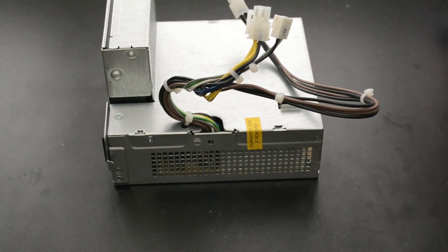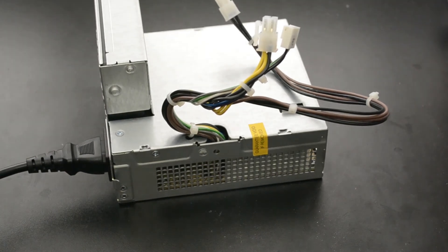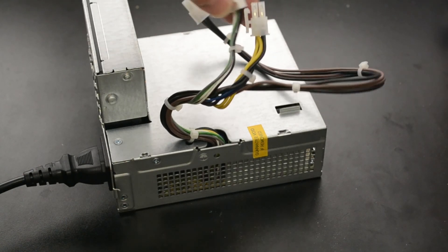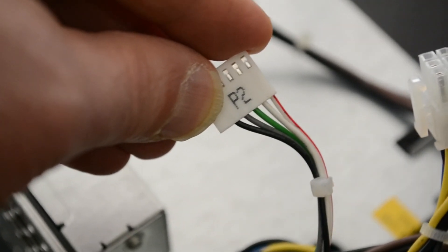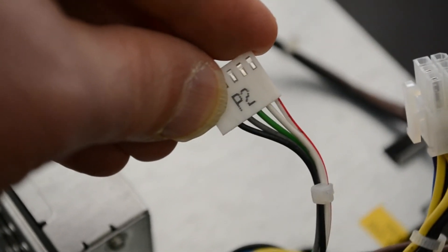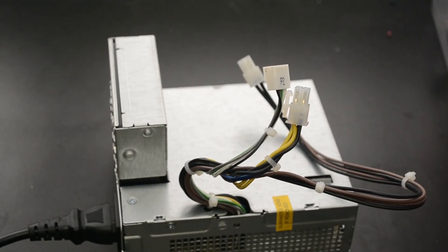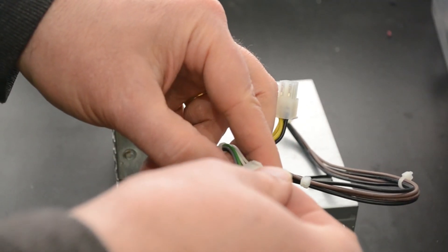But there are a couple of other differences too. Plug it in — nothing seems to be happening, and you'd be correct, there is nothing happening. The way you fire one of these things up is actually very similar to how the other power supply works. This connector here has five little wires on it, and if you look carefully, you'll see there's a green and a black one. If you remember from the other power supply video, those were important too, as that's what helps us turn this on and off, because the power supply itself doesn't have a power switch. No big surprise — the black wire is ground and the green one is what turns it on. So we'll just use a little piece of wire to connect the green one to ground.